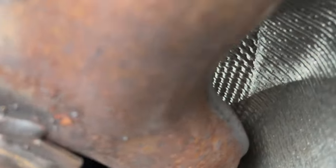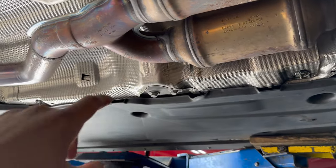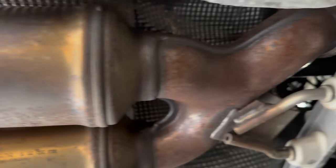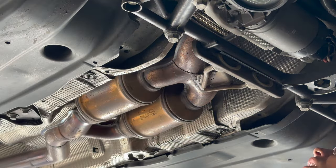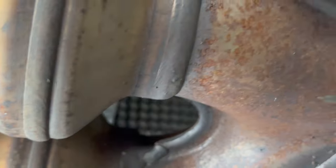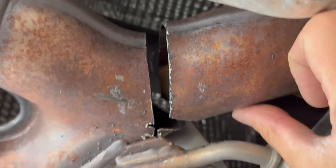To get to the driveshaft hardware it's going to be a little tight. We'll also have to undo the dog bone so we can swing the engine back a little bit to get that off. That'll give us room to pull the downpipe out eventually. For right now I don't want to deal with this whole section coming out at once since it's all connected, so I'm gonna slice the exhaust right there. They're disconnected — fully disconnected.